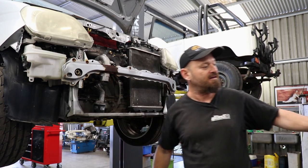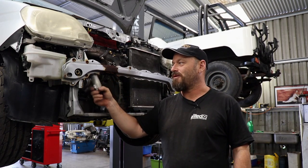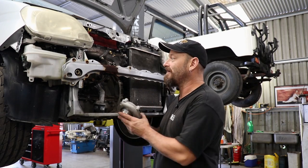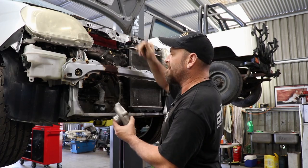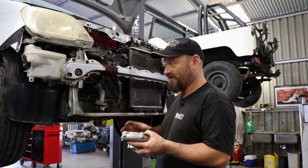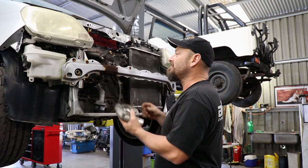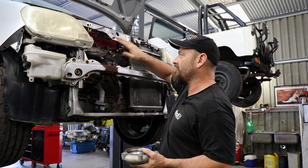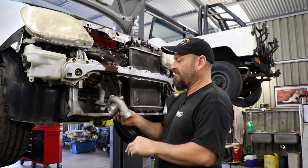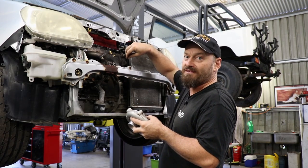It's all pretty spot on to where I want it. So now I need to pull the turbo back off and put this on permanently — it's just sort of dangling there. It's just got a big snap ring inside here — it's a real pain in the butt. The bigger ones are actually easier to deal with; these ones are really tight because they're so small. So I'll just pull that core off, leave this here, put this back together. I've got a mark on it for how I want it orientated. Then we'll make this work.